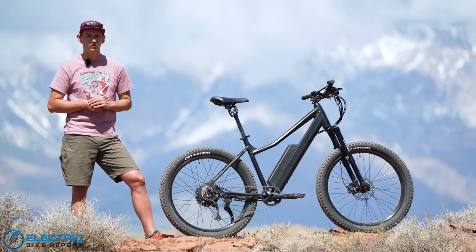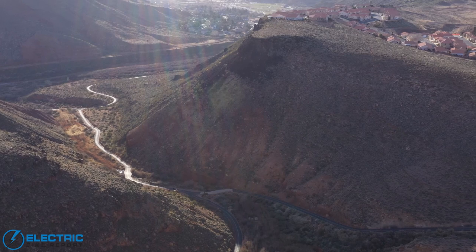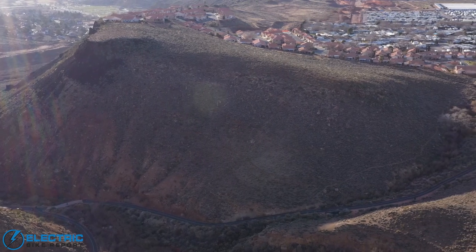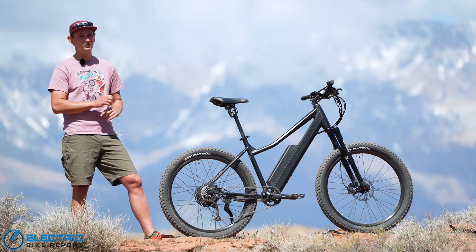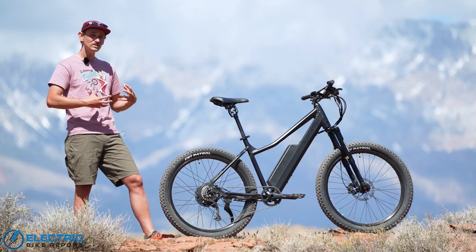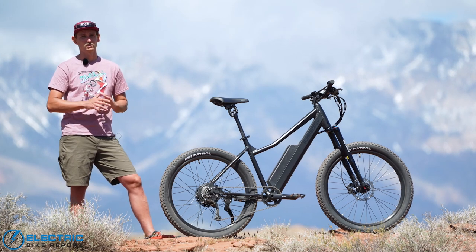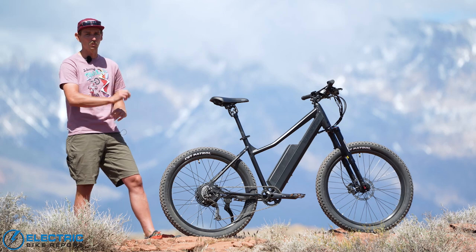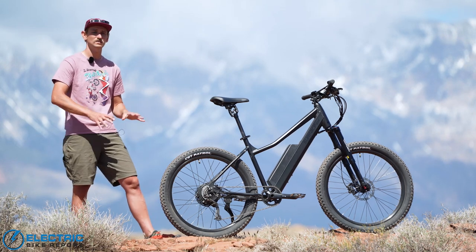To get an idea of how the Surface 604 Shred and more specifically its 500 watt rear hub motor perform uphill, we're going to put the bike to the test on our test hill, Hell Hole. Hell Hole is a third of a mile long with a 12% gradient on average — it's where we put all of our review bikes to the test, and it's plenty long and steep to really push these things. It's steep enough to push 500 watt rear hub motors really up to their limits, and we've had lots of 500 watt rear hub motor bikes not actually clear it in our throttle-only portion of the test. This bike does have a throttle, so we're going to do that test as well. But I have a lot of faith that the Shred is going to clear our hill — it's an electric mountain bike and this is the torquiest motor that Surface 604 specs on any of its bikes.